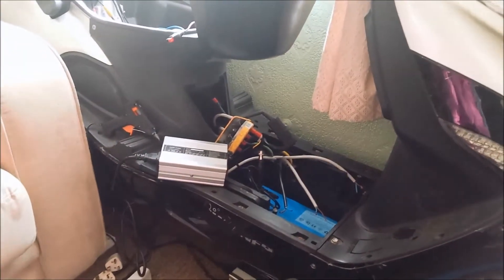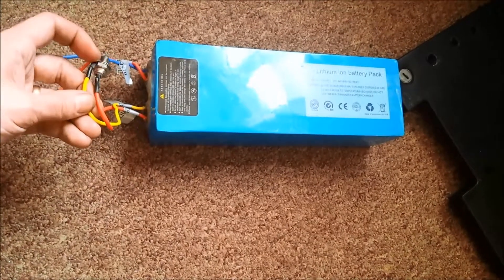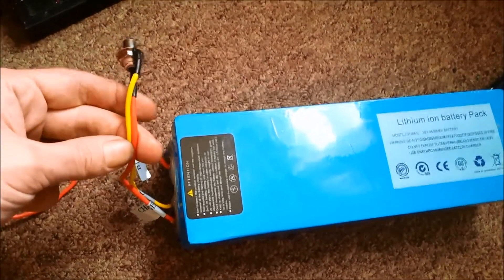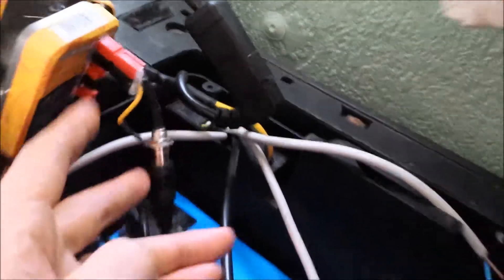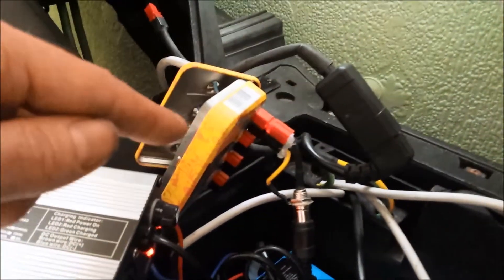From underneath the seat is where it'll be charging, running into the battery bay. This is the basic charging connection — positive in the middle and the negative connecting around the ring on the side. What I've done so I can use Andersons instead is chop these two off, pull the wires back a bit, and solder the battery onto one of the wires. The wire runs up and comes out of the tin as an Anderson. I've chopped off this bit, added it to an Anderson, so the Andersons here can connect up to the tobacco tin, which will be behind the front panel of the bike.